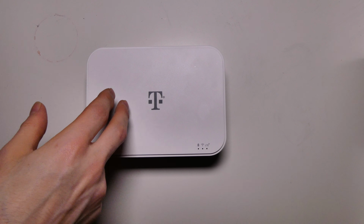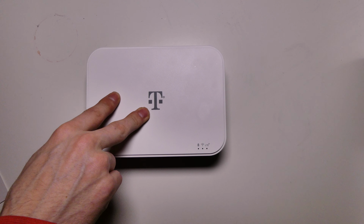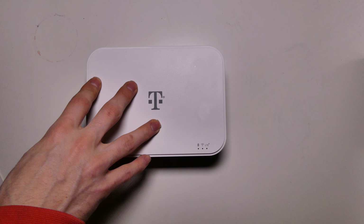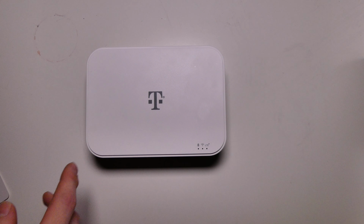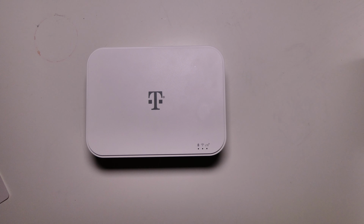Now that worked just fine as long as you set the IP address on the LAN port on this obviously outside your network. My local network is 192.168.1.xxx, whatever. So this one I set to 192.168.200.1, and it would assign IP addresses on the .200 subnet. It gave my Edge Router X an IP address in that range, and then my modem gave my Edge Router X the WAN IP address for my ISP, which is configured via DHCP. So the internet itself worked.